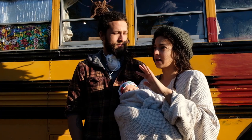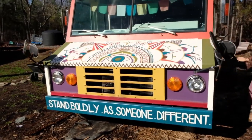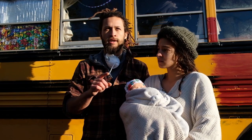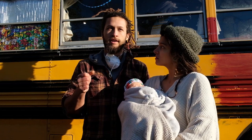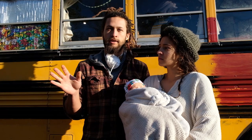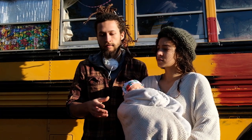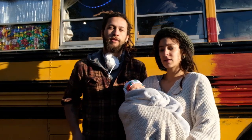You didn't like the texture that the other bus had. Well, first and foremost, it looks really, really good. But when you look really close up, you can see the brush marks, and that was one thing that I wanted to avoid. Another thing is that using those paint sprayers, you can get it knocked out so fast. You can do one side in like 30 minutes. The main thing that takes the most time is the prep work. So instead of painting it forever, take the time to do the prep and then just spray it right on. Yeah, do it all in one go.